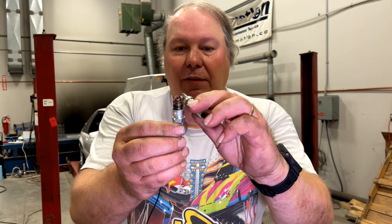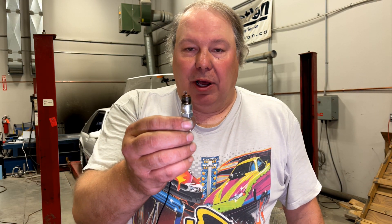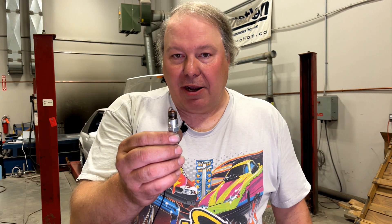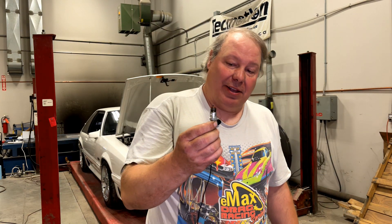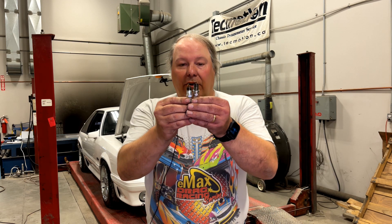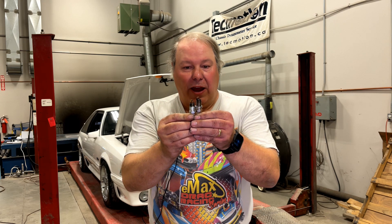What's more, if you've installed the tapered seat plugs into aluminum heads, the taper can actually damage the first thread on the cylinder heads, and you have to be very careful if you pull a set like this out. This particular set of tapered seat plugs I pulled out of a Fox body just yesterday — it had completely wrong plugs. It ran like crap, and after changing the plugs, not only did it run better but it made 20 wheel horsepower more. So if in doubt, check with your cylinder head manufacturer.